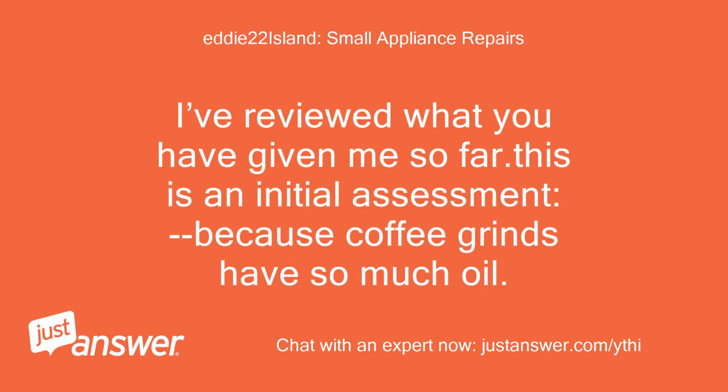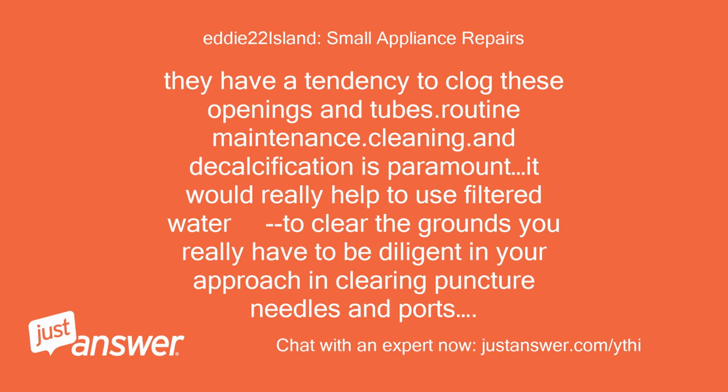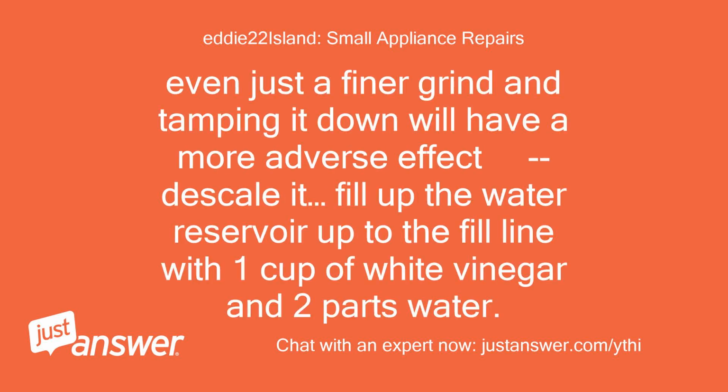I've reviewed what you have given me so far. This is an initial assessment, because coffee grinds have so much oil, and water has the calcium. They have a tendency to clog these openings and tubes. Routine maintenance, cleaning, and decalcification is paramount. It would really help to use filtered water to clear the grounds. You really have to be diligent in your approach in clearing puncture needles and ports, grinding gears or openings, and any doors or tracks. Even just a finer grind and tamping it down will have a more adverse effect.